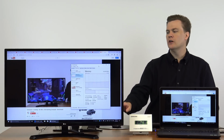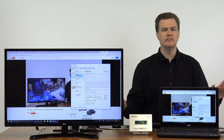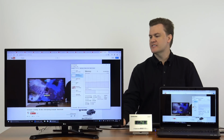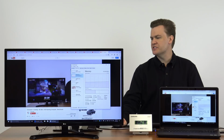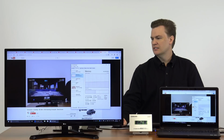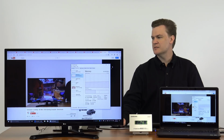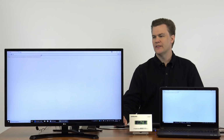Memory usage, we're at 42% memory usage. If we only had 8 gigs, it'd be completely full and we'd already be swapping basically, because committed, wow, there's 31.9 gigs committed, 7.1 is committed to RAM, 6.6 gigs is in use, there's 0 compressed, 0 free. It's using it. There's some available, but it's shrinking. That's impressive. All right, let's go open up Chrome.